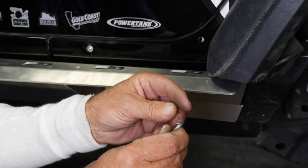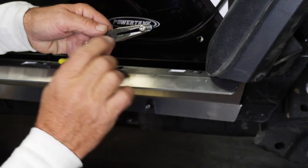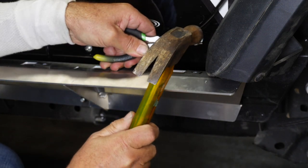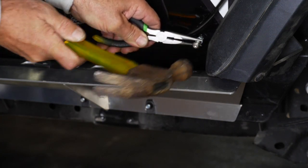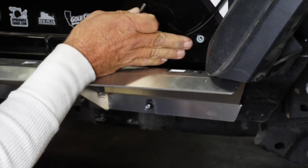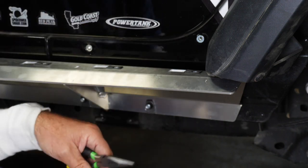I'm going to thread in a little bit longer bolt in order to pound it in. When you drill the hole for this, you want it slightly smaller than the Rivnut. You can see right now the sheet metal is flat — you actually want the sheet metal to dimple a little bit as you pop this in. That dimple lets the kick plate or whatever you're attaching meet up flat to the body, giving it a really nice look without any gap behind it.